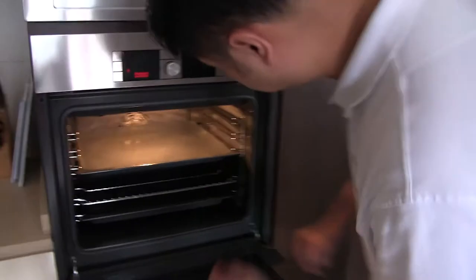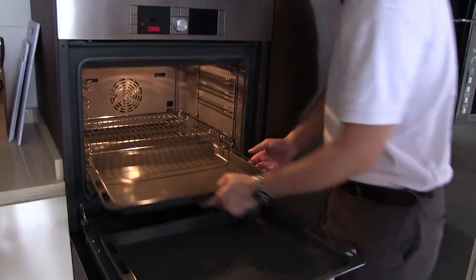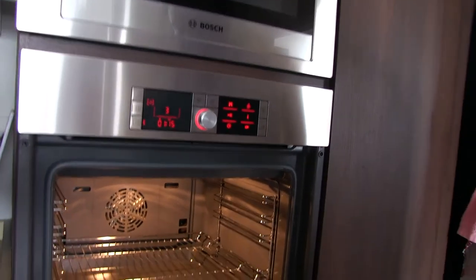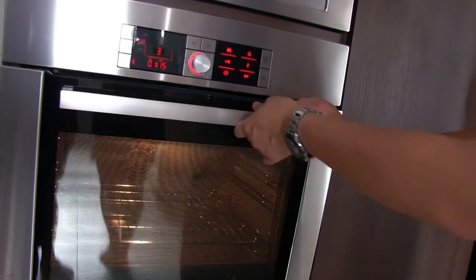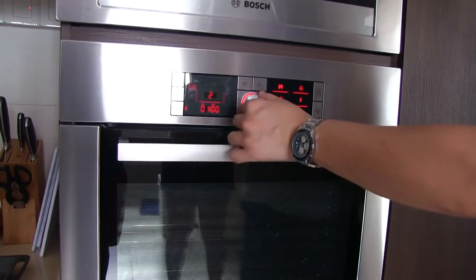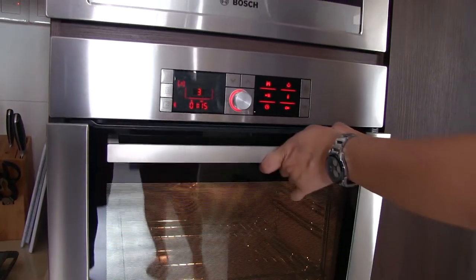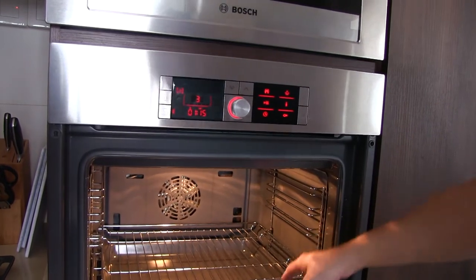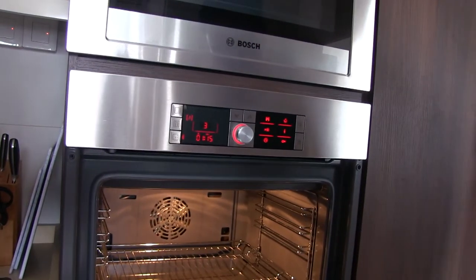The self-cleaning function covers 4 sides: left, right, behind, and top. The tray goes too. It's already self-cleaning — auto. Unless you bake or roast at less than 150 degrees, then the heat doesn't burn off for you and you need to run the self-clean for one hour. Level 1 is light, 2 is medium, 3 is heavy soiling. Most of the time when you roast at 150 and above, no need to activate it — it's already quite clean. The rough surface will oxidize it for you. Only the bottom side you need to wipe; use baking soda.